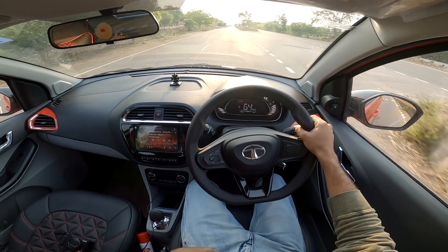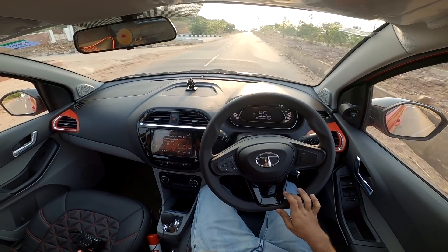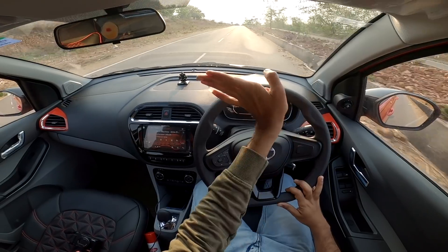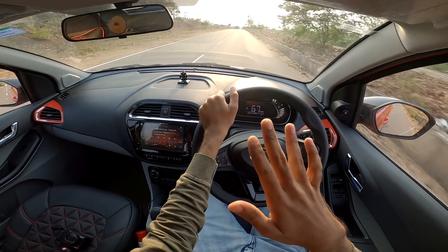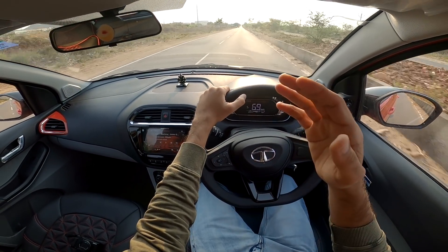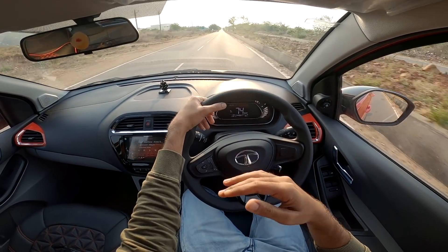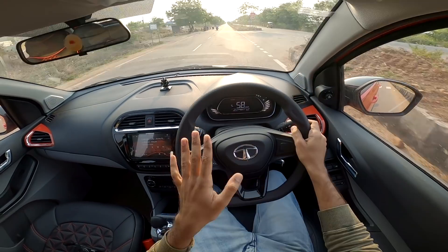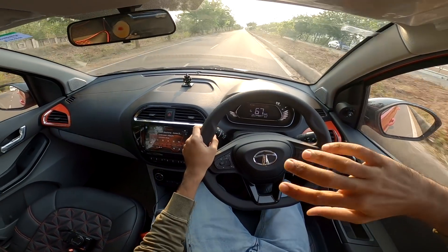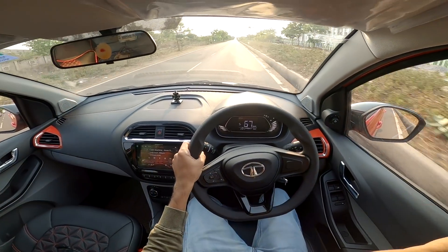There is a little bit of performance concern on hill stations. The road performance is normal — it does not feel like a manual transmission car. On a hill, the car struggles a bit in second gear at 15-16 km/h speed. It is hard to drop back to first gear and the car momentarily hesitates or freezes.